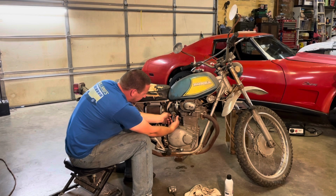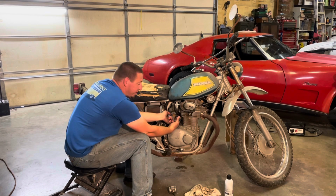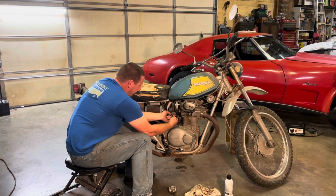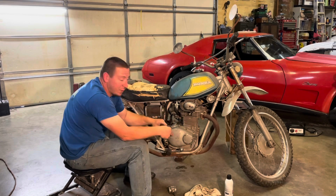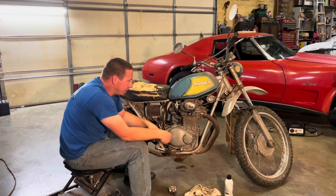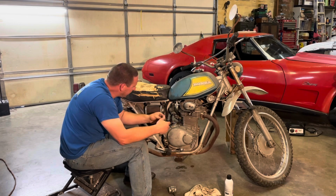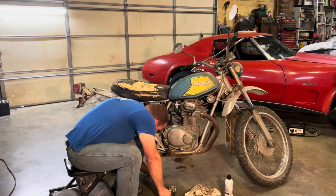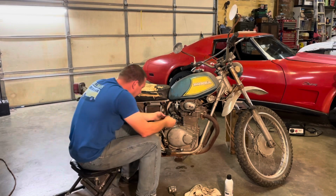That's probably closer. I've got a manual for this, but like I said, this was obviously a problem. So I'm just gonna tweak it just a little, just enough to get the fuel bowl to fill up. Once the fuel bowl will fill up, then I'll see if it'll start, if it'll run on this cylinder. Then I'll go through and adjust all this to spec, maybe buy new floats if you can get them. But anyways, I think that will be a little closer. At least try it.